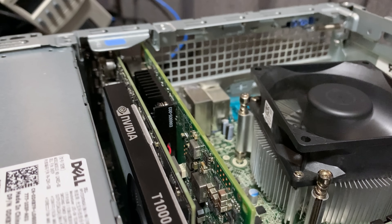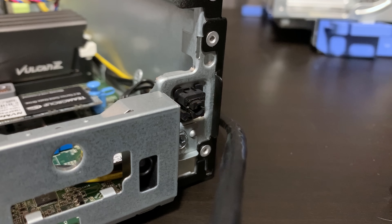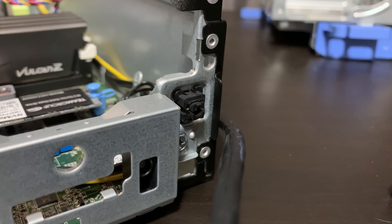From what I've gathered, I don't think this is Dell or any other OEM trying to screw you over. I think it's more of a result of the SM bus standard not being so standard. Some people will get these cards to post in a system, but all of a sudden memory channels are missing or the capacity is not being reported correctly. So I think it's very possible that there's some sort of communication on the SM bus that's conflicting with how the RAM is reporting. In my case, the system just didn't post, so I'm not sure if that's related to RAM or if the card is spitting out something that's interrupting the motherboard during POST.